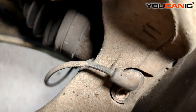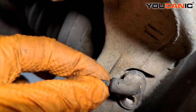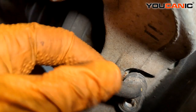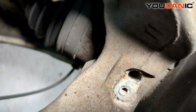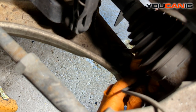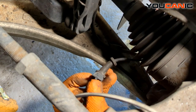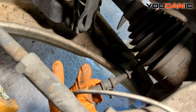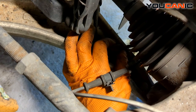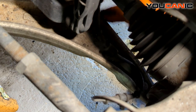We've removed the bolt. Now move the liner — sometimes it moves easily, sometimes you've got to do some work. This one is able to move, and then we can pull the sensor unit out. Now follow the cable down around here. We have a connector right at the bottom near the ball joint, and then another one right here on the A-arm. Work our way back — we've got all the ones done on the A-arm unit.